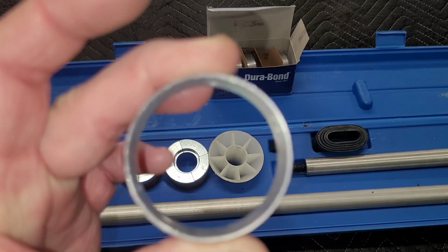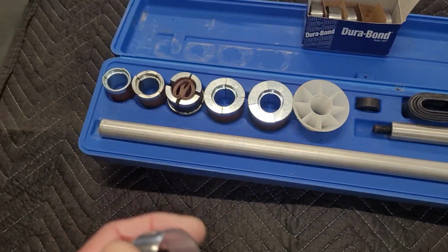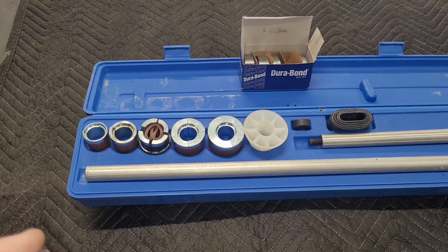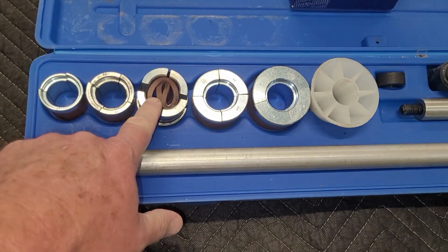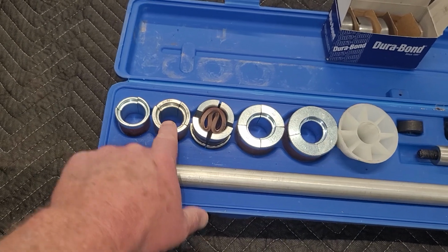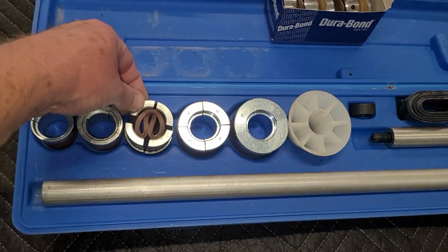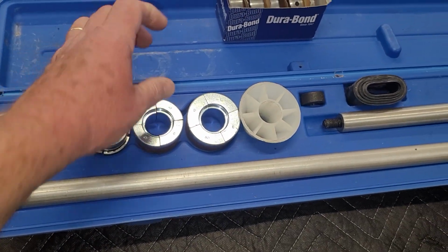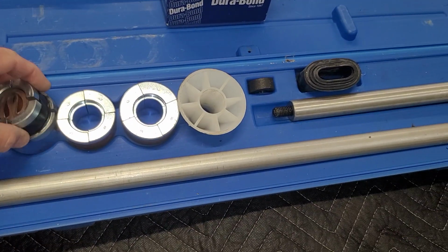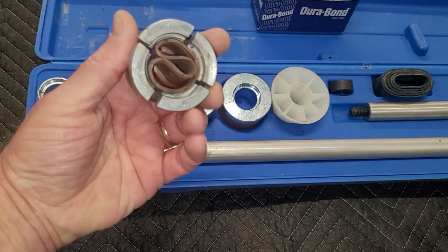On two of them, putting in a 383, and I believe it was the center bearing, so it was using this number 3 size collar. The number 2 is what you use to put in the back bearing. It worked fine, it had enough shoulder. But on this one, the rubber was so thick, it left just enough on the edge to get the bearing started. And on two of them, about halfway in, you hit it, and this shoulder jumped inside the bearing and destroyed the bearing. So I did the second one, and it did the same thing.